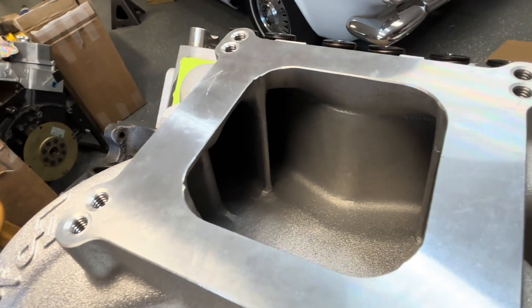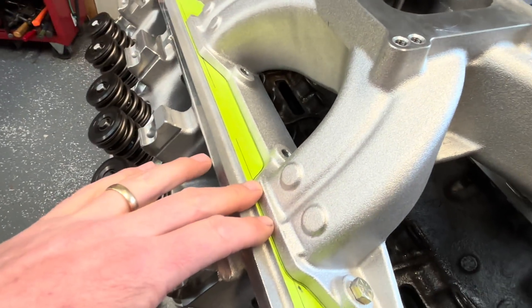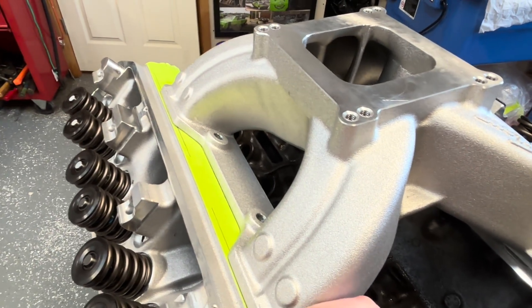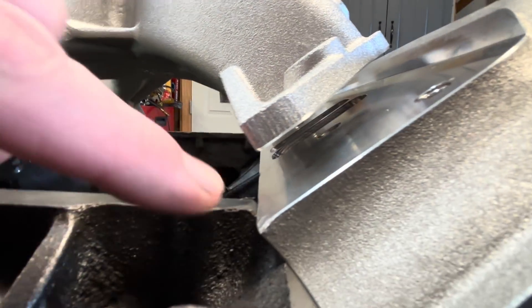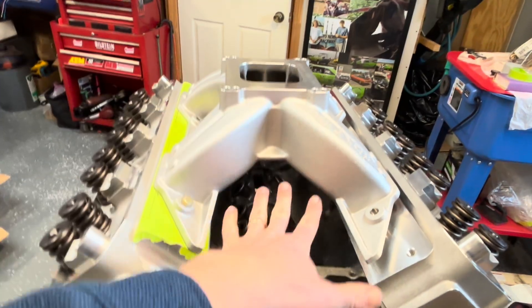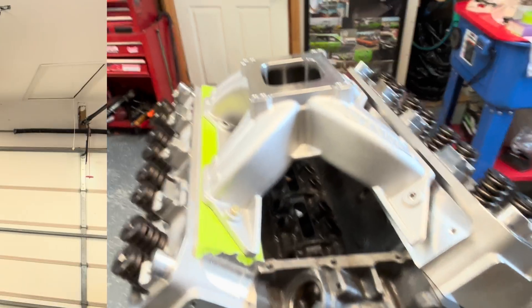The air at the roof is kind of what matters the most. Having that port alignment is drastically more important than the other sections. Here's the difference I wanted you to see in the 240 head versus the 270 on the intake. If you can see the distance from that spot — imagine a straight line going there — that's how much that intake would drop with the 240s. That is one of the major considerations in choosing your cylinder heads. On every build I've done, people always comment and say why didn't you buy 270s or max wedge ports of some kind for that engine?